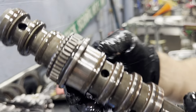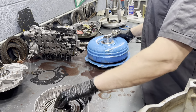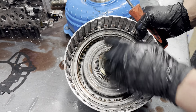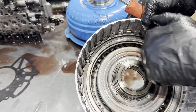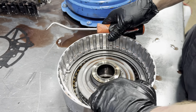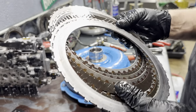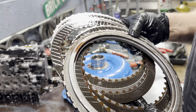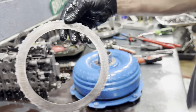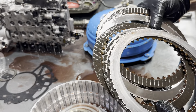Like I said before, the 8-speed — it's the valve body that causes the problem. We're going to look at our 1-3-5-6-7 clutches real quick. The way the snap ring sits in here — if you look at that top pressure plate, you can see that little nub on the top backing plate; that's where the opening of the snap ring needs to be. This is the only stack that doesn't use a wave plate out of this whole trans. The catalog is correct — four steels and four fibers. There are some heat marks on the bottom steel, but all in all these really aren't terrible, aside from that one slip.